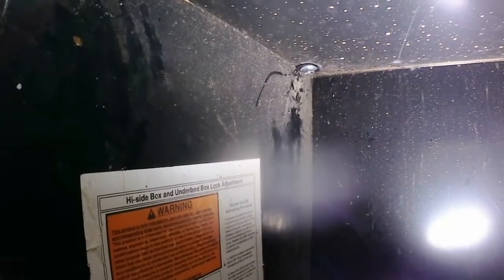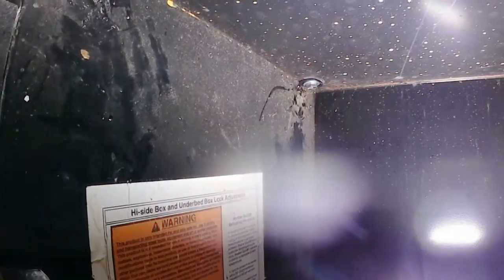At some point my camera died, so I'm not sure how much you saw, but I've got a bolt there and a bolt there — they come down from the top. Between the washer and the fender washer in the box is a neoprene washer to seal the hole. That's a nylon lock nut up here with the same neoprene washer, but I had to go with a smaller metal washer. Those got red Loctite and the holes are actually tapped into the bottom of the bed.